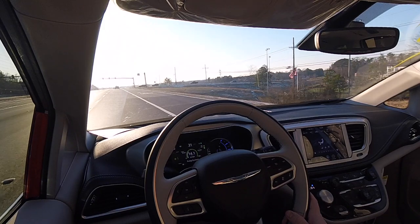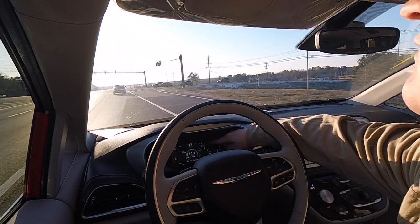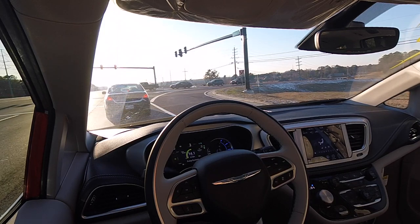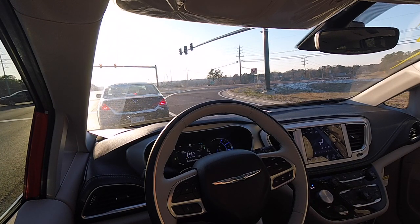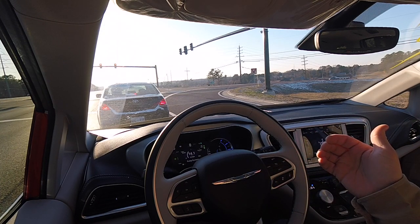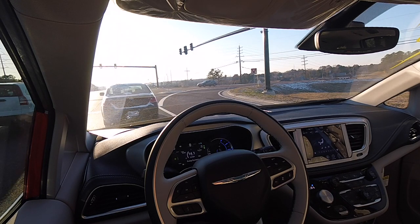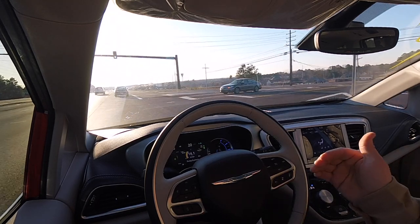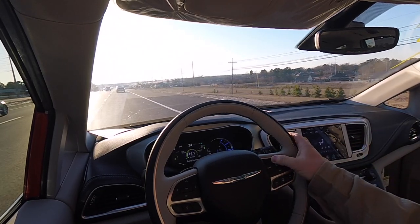I've now got the adaptive cruise control set and it sees the vehicle in front of me. This has a stop-and-go feature — I'm set for 37 miles per hour but the vehicle is bringing me to a complete stop. It will get up close and then we stop. When the vehicle ahead resumes acceleration, we will resume speed also, but only up to my set speed. With a soft tap of the accelerator the vehicle resumes — this is so that if traffic starts moving, you don't automatically start moving; you just softly touch the accelerator and the vehicle resumes speed.